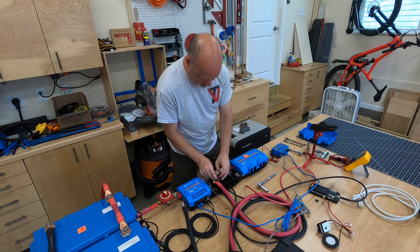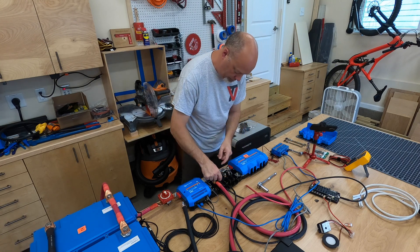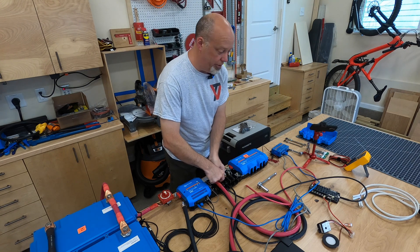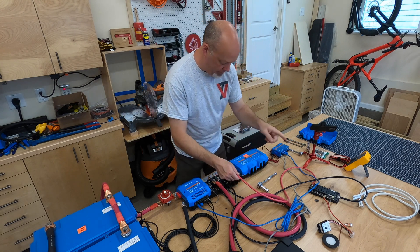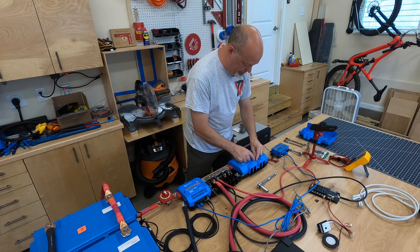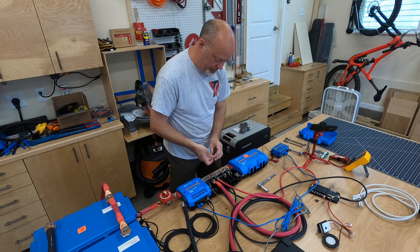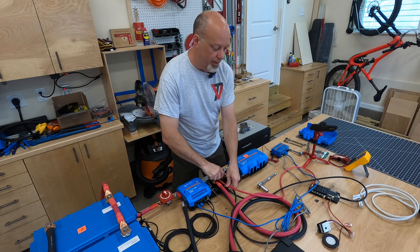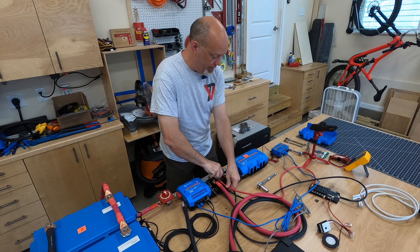And go for the positive. I did my math for you for how I came up with my fuse size on the Blue Sea Systems panel, so just know that I have a 2-amp fuse — more than enough for just this one switch and LED puck light test, and that's what I'll need for my group of four LED puck lights.